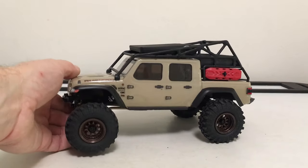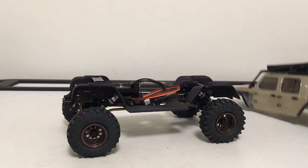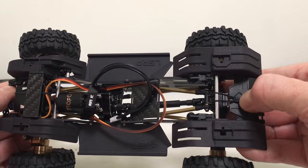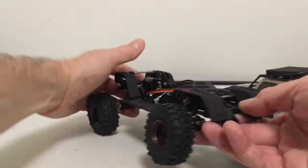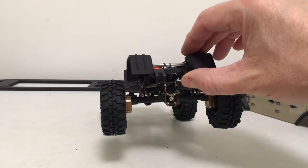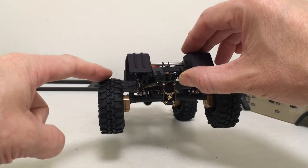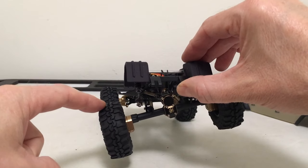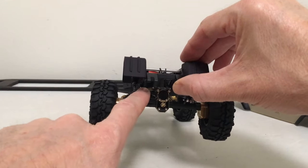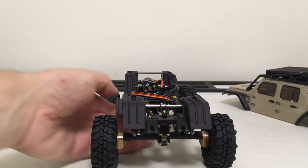The other thing you can see here is the rear end is kind of Carolina squatted. That's because I've already started tuning this. I've got a rubber band limiter strap in. You can see I put a screw in, a little plastic washer. That basically keeps my axle from dropping out on a descent. Gives me a nice center pivot, so it holds the shocks just like there were no flex blades. But I can still articulate and pull those flex blades down to full extension. It just doesn't let this axle drop or the body pick up on a descent. So that's a nice little bit of tuning.